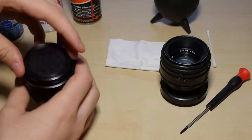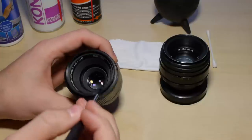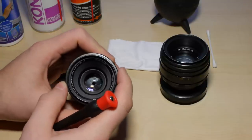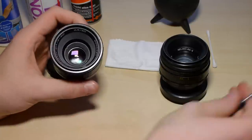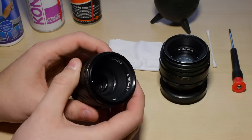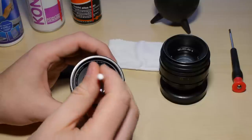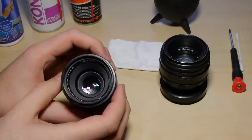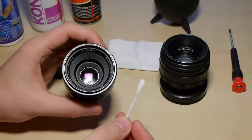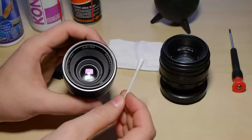It's also possible here — here you have your notches, here and here, and if you unscrew them you can remove the lens elements and clean them up, and maybe clean up the aperture blades which might be oily at the front. Don't forget that it can be quite tricky to get the lens elements back in, because they sit very deep inside the lens. You may need to use a Q-tip or similar tool to get the lenses back into position. Be careful not to lose any threads from the Q-tip, because otherwise they'll end up inside the optical system. Also be careful when using Q-tips to clean the aperture blades, as you may also lose threads there.